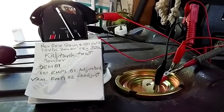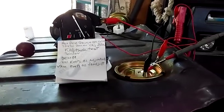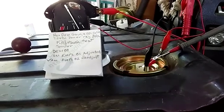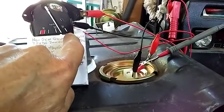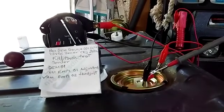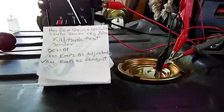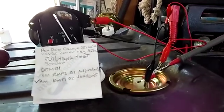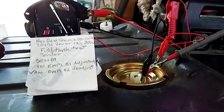Here's what we're seeing as the dilemma. We have the gauge showing about three quarters of a tank at that 17.5 ohms. Now, if I were to have not calibrated this gauge and put that 7.5 regulator on it, it would have been reading way up over here in almost 1.1, which would be full. Although that would be great, it would cause the other readings as it goes down towards empty to be thrown off. So it's kind of a catch-22 — if you don't do any adjustments, you're just going to have to live with knowing where empty is going to be and see how it works.